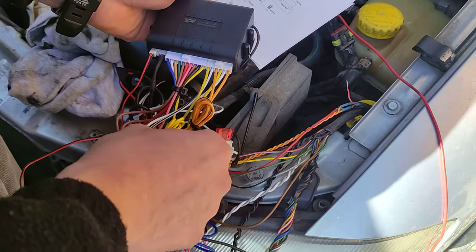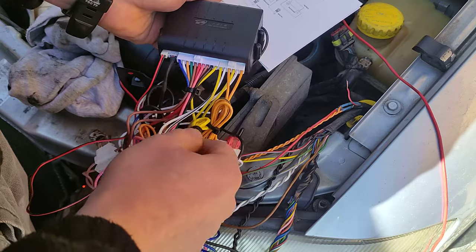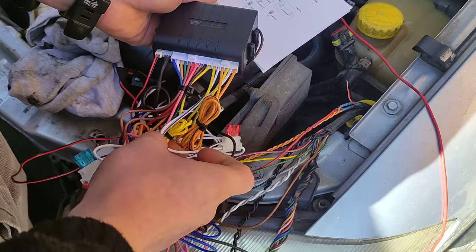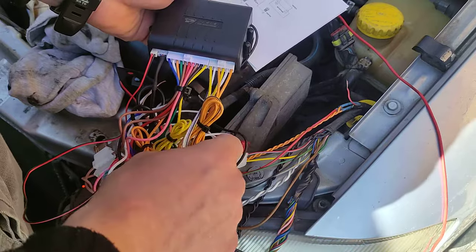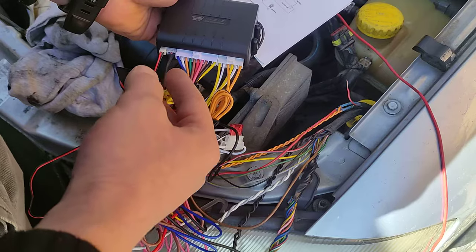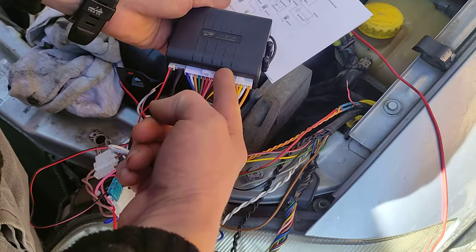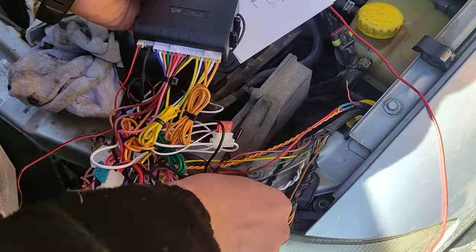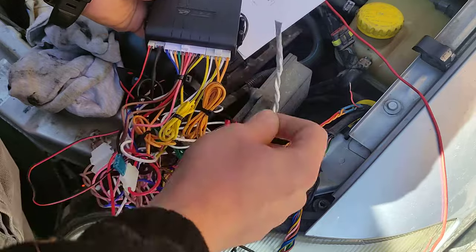The relay is to cut power, for example to the fuel pump. I'm not afraid of someone stealing the car — I just want to know when someone is tapping on it or get a notification. The immobilizer on the car is already running. More expensive alarms have the immobilizer built in. So these two wires would go to the fuel pump — you just plug them straight in.